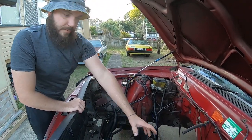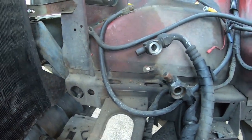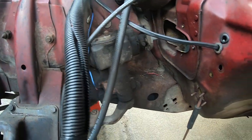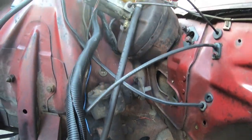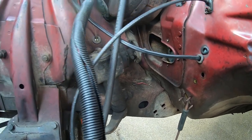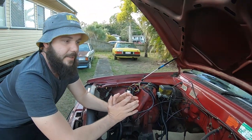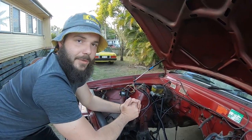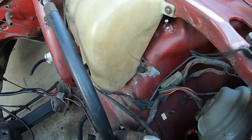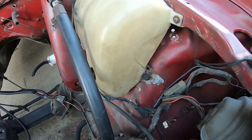You can see the whole rail goes along here and you just check that it's flat and square, that all the welds look good. There's probably been a little bit of rust leaking off that master cylinder area, so we're going to take care of that light surface rust around the steering box. To find trouble, even the most perfect of cars — it doesn't matter how good they are — generally under the battery tray you'll get a little bit, or under the washer bottle.